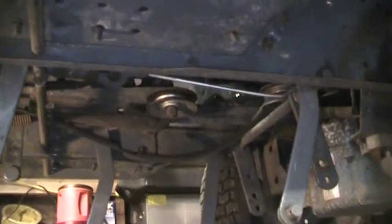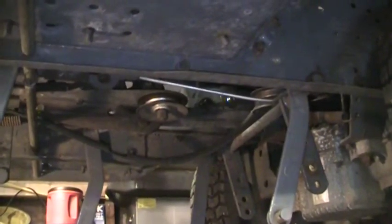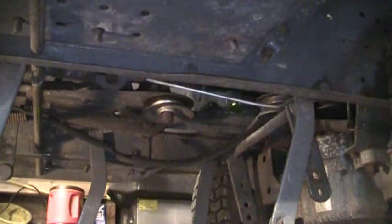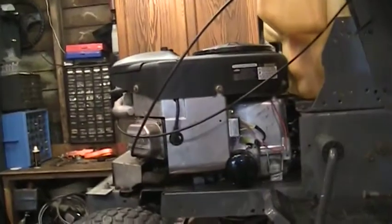I know I need this pulley. I doubt I'll be able to get it by application so I'll have to go by size. It's a V-pulley — it'll have a certain diameter and certain bore size — then I should be able to get a generic pulley for it. We're going to go over the deck and make sure all the idlers are in good shape too. I'll get that pulley out, get the new belt in, get the engine bolted back where it's supposed to be, the exhaust bolted back up, the fuel tank bolted back, and carry on.